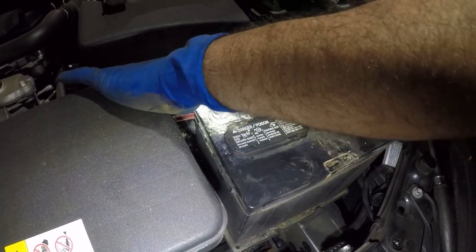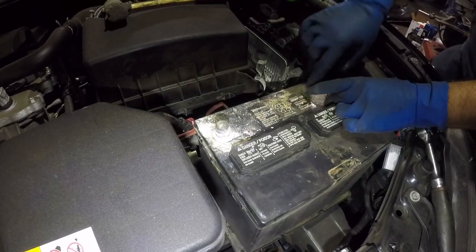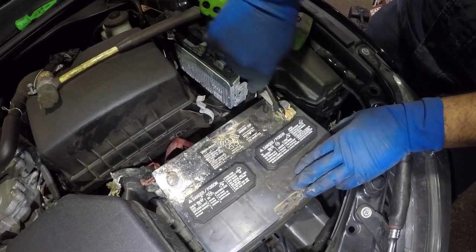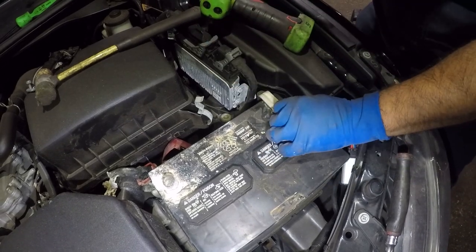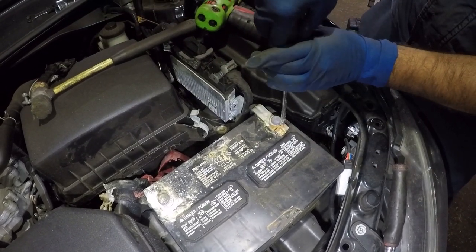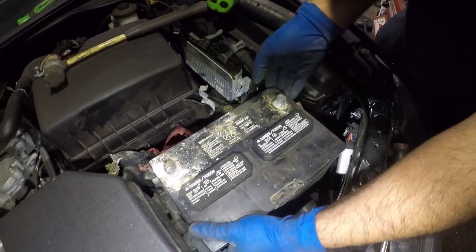Be careful — there's really contaminated stuff here. Put this to the side and make sure it does not touch anywhere on the metal. We're gonna loosen this side up a bit more using the number 10. Notice it's disconnected and your car did not shut off — that's a sign you have a good alternator. The car is now running off the alternator. Once you have this open, we're gonna grab this battery and put it to the side.